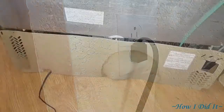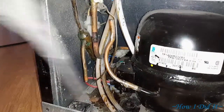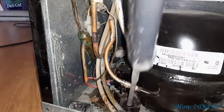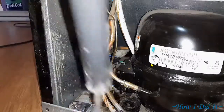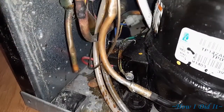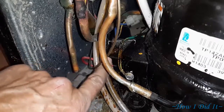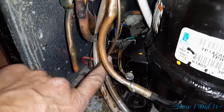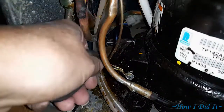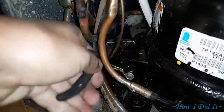The first thing you're going to do is unplug your refrigerator, pull it out, and remove the little cardboard cover on the back. Now while I was initially vacuuming this about a week before, the starter relay on my refrigerator — you can see it right here — it was overheating. You could hear the refrigerator trying to click in and out and it wouldn't cycle on, then it finally came on. So when I was vacuuming it out, I noticed that this part was bad.